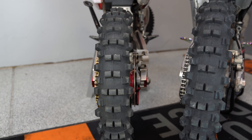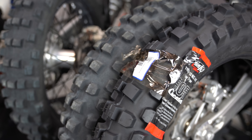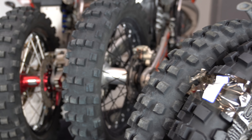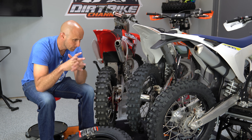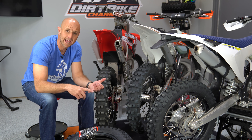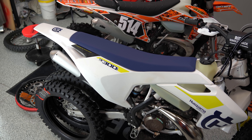I think the 505 is probably best for rocky terrain or hard pack terrain because it's got those close knobs together — a lot of rubber hits the trail. It's really good for out here in the Rocky Mountains in the summer months when we're riding alpine single track, and it works really well on rock and slick rock. Where the 505 suffers is in the sand and in the mud. I think that's because the knobs are pretty close together.